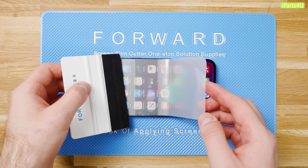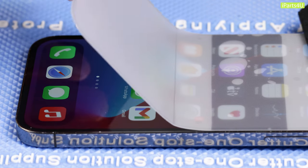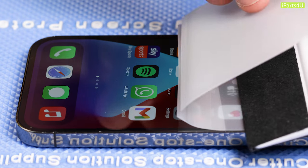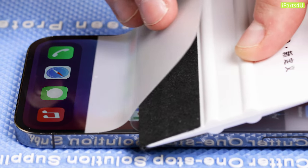Starting at the bottom of the phone towards the charge port, lift the film up with your fingers or tweezers and peel it backwards. After peeling back the film to halfway, you will notice the film will split and will expose the sticky layer that will fix the film to the phone. With your application tool, slowly slide it along the film until you reach the end of the phone.